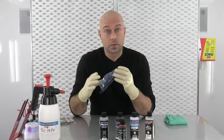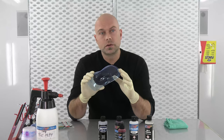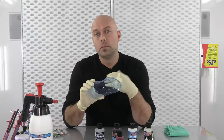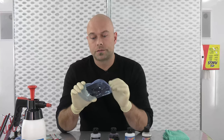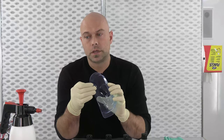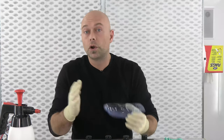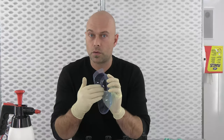So we're gonna get right into it. Plastic — in this case polycarbonate — these are a little more difficult to prep in that you have mold release and these are very finicky in terms of fingerprinting and staining. Because we're gonna paint from the inside out, you want to be very careful in your cleaning and what you use to make sure this is really clean, because you're not actually going to scuff or do any surface prep to this — you're gonna paint right over that polycarb.